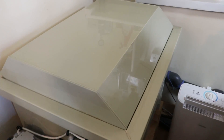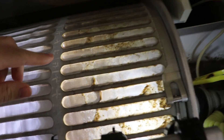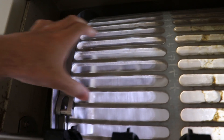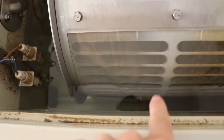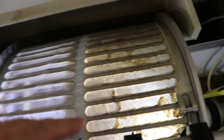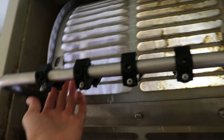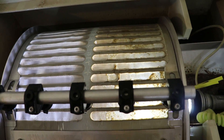So I'm thinking about changing that pump to see if I can get more from it. You can see now it's come to an even muckier section — this should have all come off and been clean, but it hadn't. For some reason this bit stays clear; I think it's because the UV light is just here and the UV light stops here. I've turned it off so I can open the lid. Obviously the UV light must do something to this that breaks it down a bit so that the jet washer can take it off quite easily, because all these spray bars spray at the same pressure.